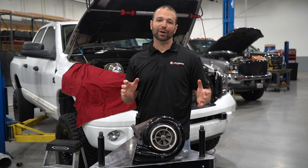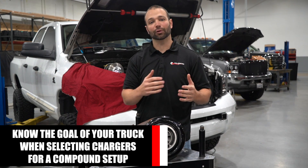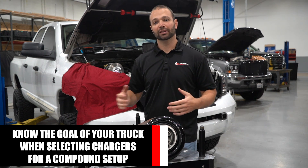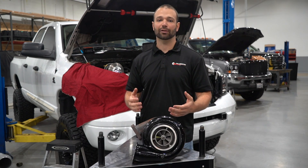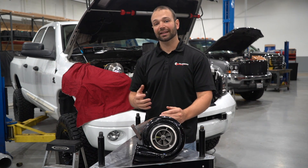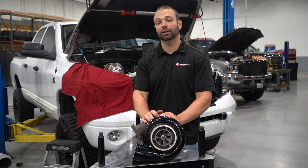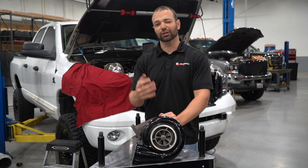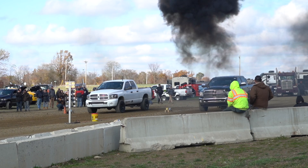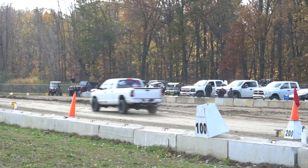Compound kits have really wide operating ranges, but they're not perfect for every scenario. A kit that works really well off-idle to 3,000 RPM is not going to shine at 4,000 RPM — the drive pressure is simply too high. We still have that small turbocharger in the valley with a turbine limitation. Even if you upsized the turbine assembly, that might get you another 300 to 400 RPM of safe performance, but it's still not a 4,000 to 4,200 RPM setup. Twin and compound kits that make big power up top have really big turbine assemblies in the valley.